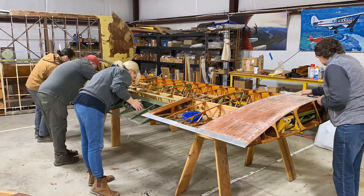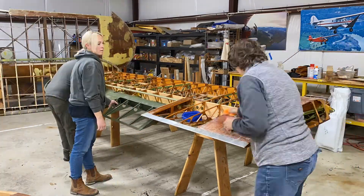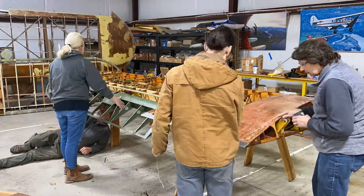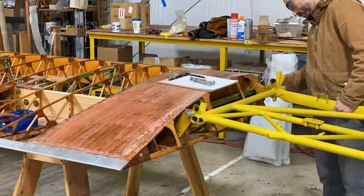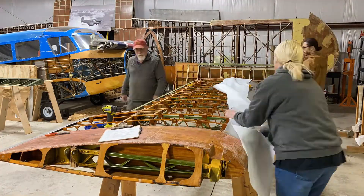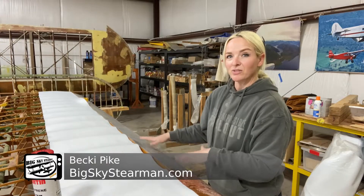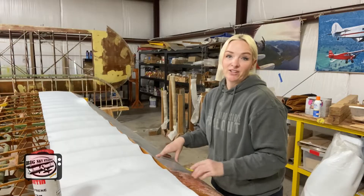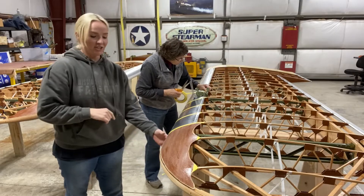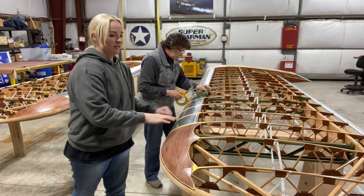First, test fit the aileron and sand down any rough edges on the plywood step. Test fit the wing to the fuselage. We add felt to a leading edge because over time the metal leading edge can shift and cause cracks or wrinkles in the fabric — plus the felt protects the fabric from all the nail heads. Another thing to do is to add chafe tape on any of the sharp edges around the wing.